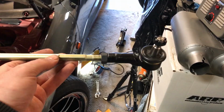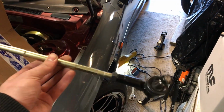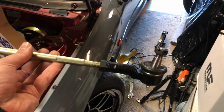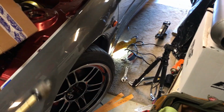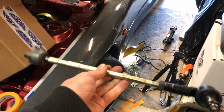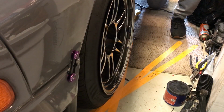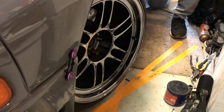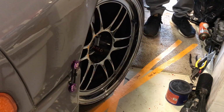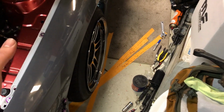So now it is time to swap in my mystery tie rod, inner outer tie rod. And for now, we're gonna use the 2 washers that replicate a 4mm spacer on these threads. Now, I'm gonna disassemble and throw this guy in. I'm not gonna bore you guys with it. So let's see how our spaced out setup works. My phone died and I lost a lot.